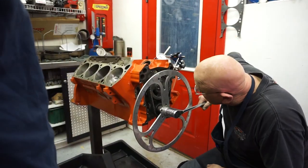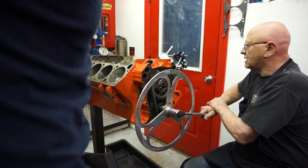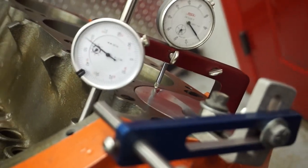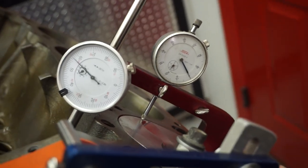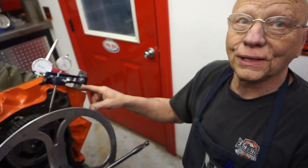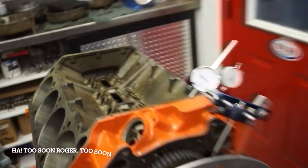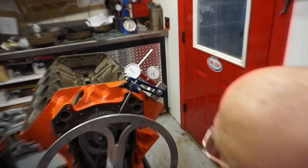Which is line up the dots. This indicator is coming up hitting the piston — okay, so this is coming up to top dead center. She's at zero. It's really nice to have this piston up here instead of down like this one, like we had before. Yeah, no more 7/16ths of an inch missing. So you're setting a zero there and you set your pointer here to zero.